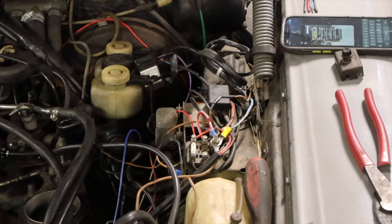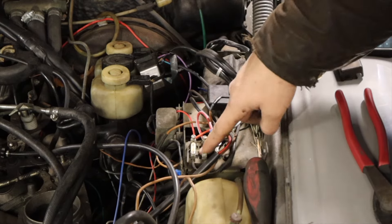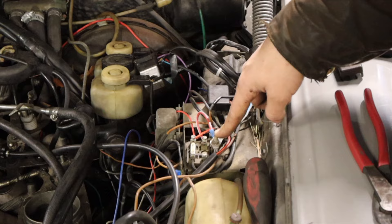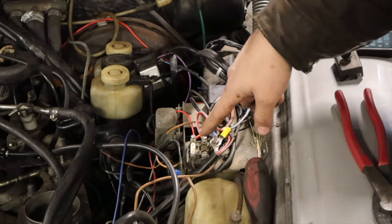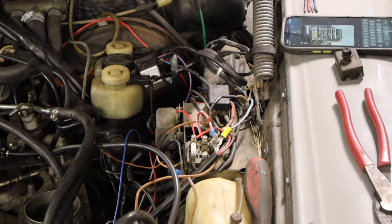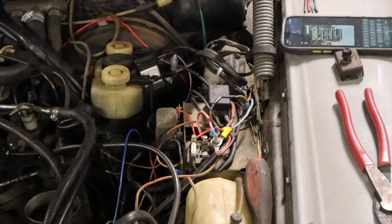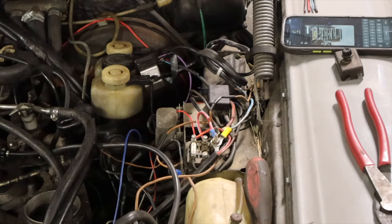I had an open fuse holder and this is a 12 volt supply from the battery/alternator, so I just took a lead and put it to that open fuse — that can be used for our injector power. We'll still need a main power fuse, but I think I'm going to steal something from the other side of the car where there are some other fuse holders.